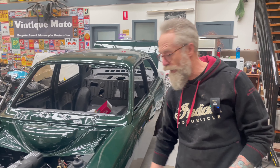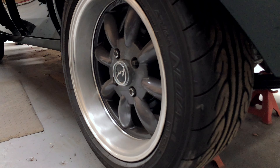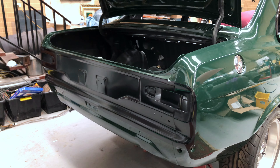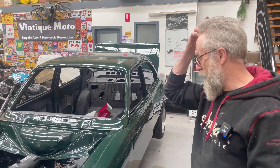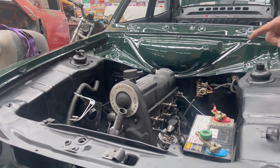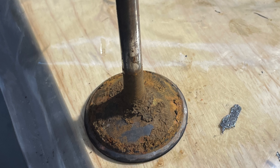It's a pretty special colour as well. It is — it's an Aston Martin Vanquish Green, British Racing Green. They said they wanted a white car at first, so everything was prepped up in white, then they changed their mind to green or grey. We steered them towards the green — it's more of a classic racing car colour. He wanted a street-track racing kind of thing, so we've even flared the guards a little bit wider. We had to pull the guard, flatten it out, add a piece to it and fold the edge again, and it's come out all right. We've ended up just flaring out the standard guards and pulling out the rear ones to suit the wheels, so it will still get a road registration.